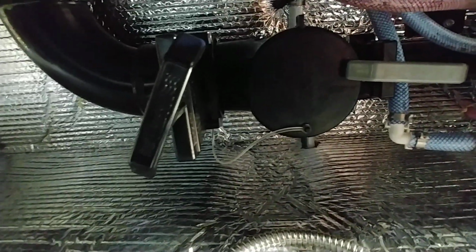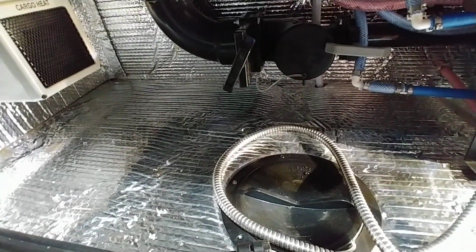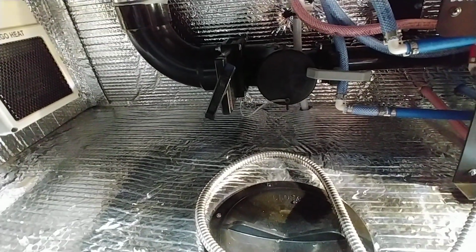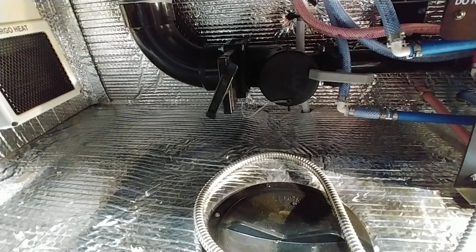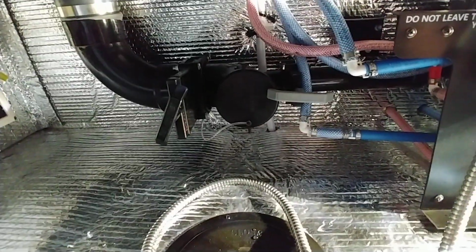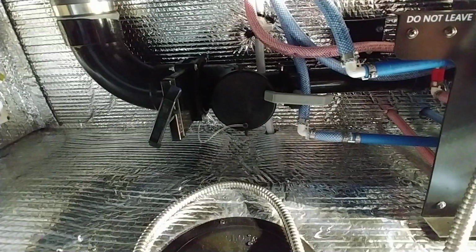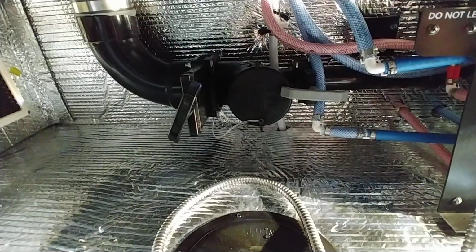The black tank is going to be the black valve, or black handle. And the gray tank is going to be the gray handle. Fairly simple. And there is a cap back there so you can drain from that point. The big thing with that is I always suggest with the black tank, make sure you leave the black tank valve closed if you're at a full hookup campground with sewage. Mostly because what happens is you get a pyramid of solids in there. We don't want that. Let it fill up mostly and then drain it. The gray tank you can leave open all the time. I'd still suggest leaving that closed just so you have something to rinse the excess solids out of the hose.